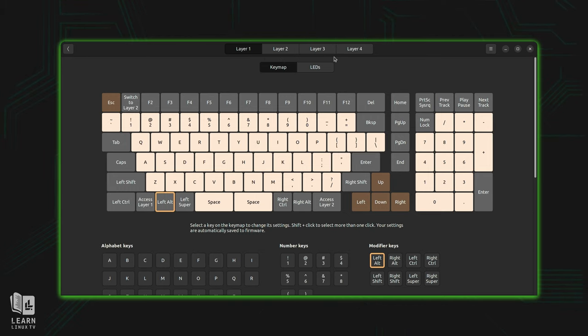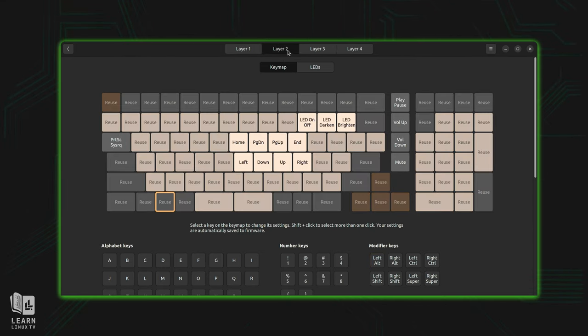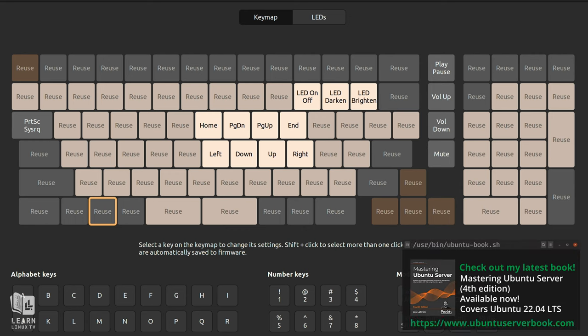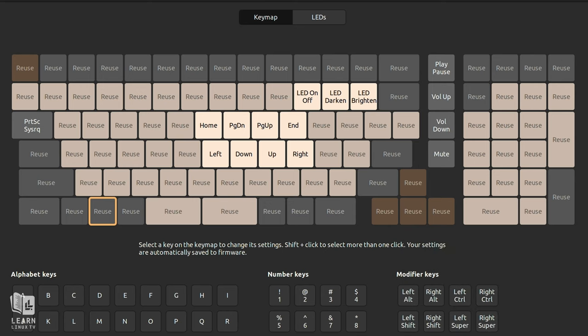There are also several layers when it comes to the keys — think of layers as alternate key maps. Using Configurator, you can change the LED color of each layer so it's obvious which one is active. There's a second layer configured right out of the box: hold Function and the purpose of some keys will immediately change. For example, Page Up and Page Down become Volume Up and Volume Down. Zero, Hyphen, and Equal become LED Toggle, LED Darken, and LED Brighten respectively. Any changes you make are saved right into the keyboard itself, so you won't need the Configurator app running to keep your settings in effect — they follow the keyboard even if you plug it into a completely different computer. You can also export your settings to back them up and import a colleague's settings.